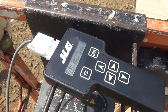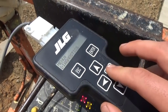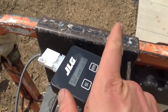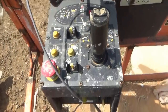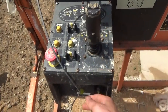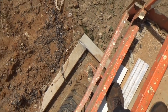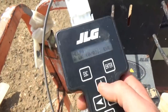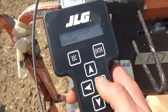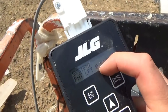Now it's open. So what doesn't it like? It doesn't like the right rear pressure transducer. So now let's let ourselves down. Push the outrigger button or the leveling jacks — see how they're descending. Hey, look — it says everything okay. So again back to diagnostics and system — let's look at these pressures. When this thing hits the ground, that pressure should start climbing.